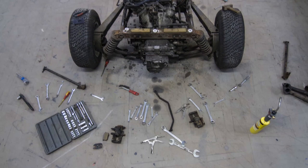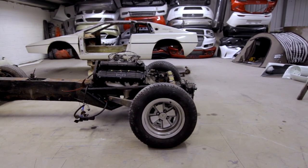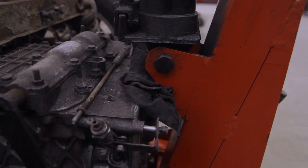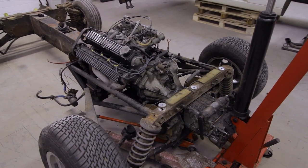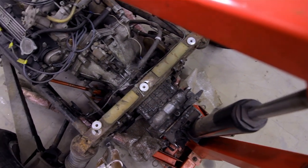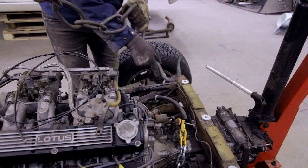After all that, it was time to start cleaning up and getting ready to hoist the engine. Then I ran into a little snag — the car is now sitting too low to let the hoist come underneath it. But no problem; there's very little weight here and I didn't mind jacking it up. I have the hoist set at its maximum reach, rated for a quarter tonne — 250 kilos. I think this engine weighs in the region of 125 kilos and the gearbox maybe 40 or 50 kilos, so we're under 200 kilos. I haven't drained any of the fluids, by the way.